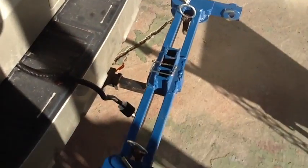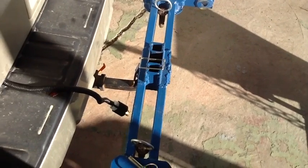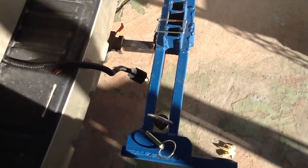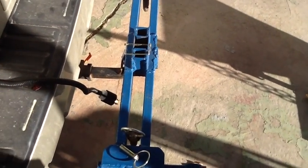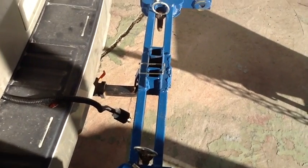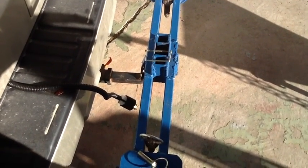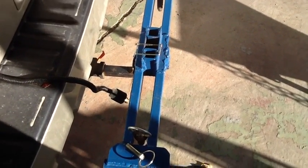As I mentioned when I showed the pictures of the design I based this off of, that frame stuck out probably 2 feet — 30 inches or so. My design only sticks out a little over a foot, about 14 inches. That makes it safer because the thing's not hanging out as far, and also the further you hang it out there the more weight you've got on your hitch.